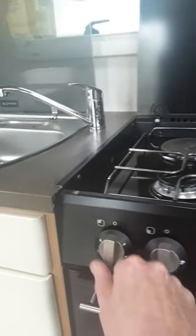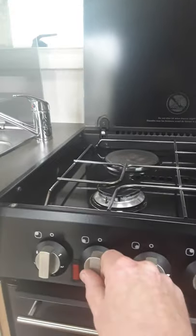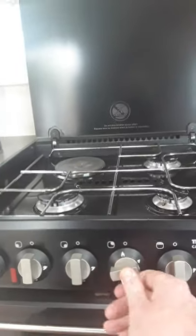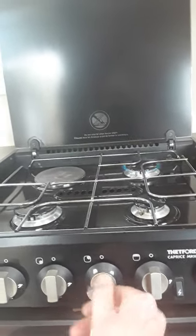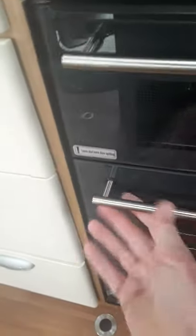It does heat up fairly hot. I've seen it before where somebody's put the glass down on top when it's on, and it just shatters the glass — that's the worst case scenario. You can see here you have an igniter. You turn the knobs and that's your different rings lit. There are safety thermocouples in these as well, which means the gas won't come out until the ring is actually lit — so it doesn't matter if somebody starts screwing with them, there will be no gas coming out. You have your grill and your oven at the bottom. The oven — you just have to make sure you open it from the left-hand side; it actually swings out that way.